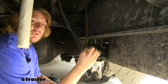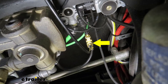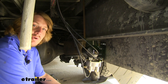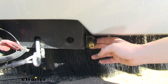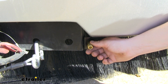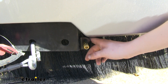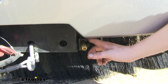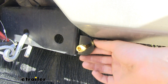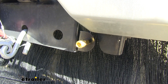To make your air line connections from your motorhome to your unit, you are going to have to tap into the brake system and use the supply air and metered air that goes to your rear brakes. Now this is going to vary depending on which motorhome you have. Mounted back here by the hitch on our motorhome, we have our female valve that will make the connection from our motorhome to our Jeep. The output air line from the unit underneath, you'll just run that back here and plug it into the back of this valve. The mounting plate for the valve is pre-installed and comes included. There are two bolts that come with it, however we decided to use self-tapping screws — self-tapping screws do not come with the kit.